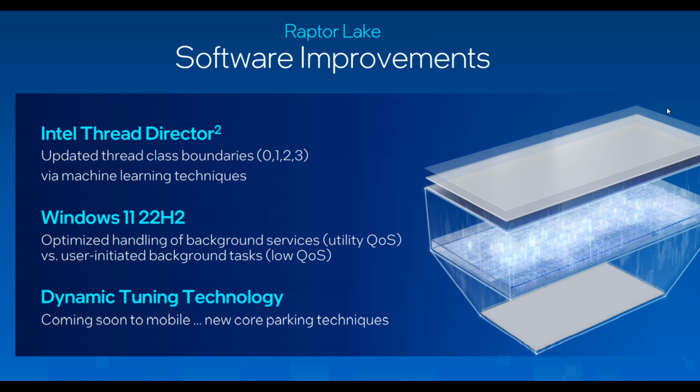And then there's also AVX, AVX2, AVX-512, all that kind of stuff. And it shows how Thread Director basically allocates them and moves them around. Now, for Thread Director to work, three things have to be done. First of all, the most important thing is for the highest performing cores, which are the P cores, to be used first for single-threaded and multi-threaded performance. Like if there's nothing else going on, you want your P cores being used, right?